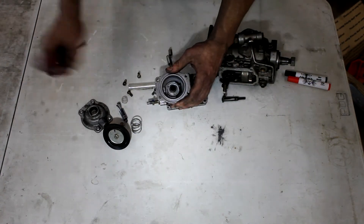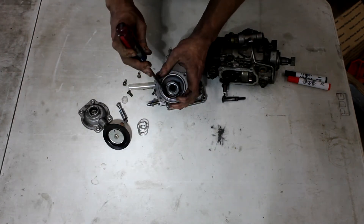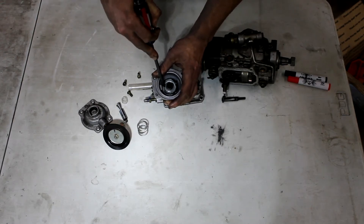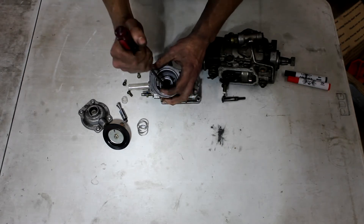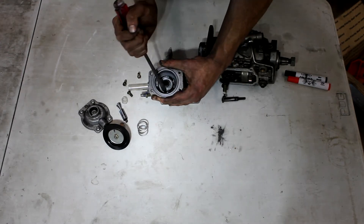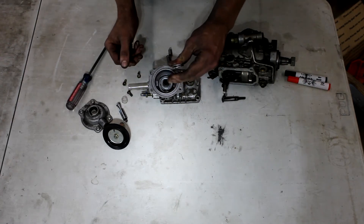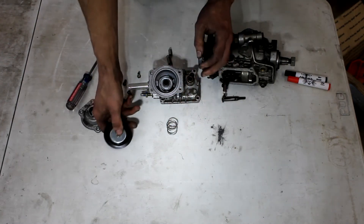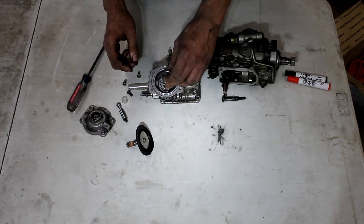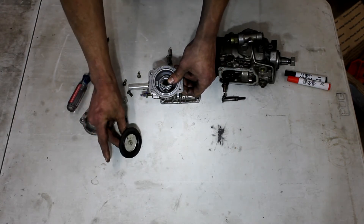This is the star wheel. This adjusts how high or low the spring is. You just turn it with a screwdriver for fine adjustment on the preset spring pressure. So on top of being able to set how much fuel you have pre-boost, you can set how long it takes in terms of pressure to build up in the system to get to full available fuel.